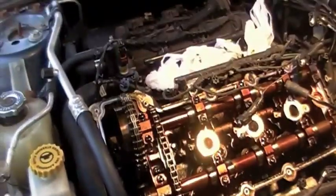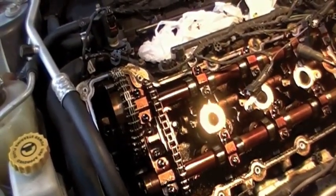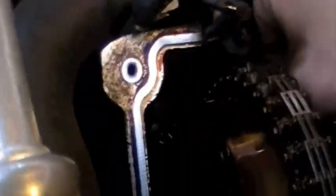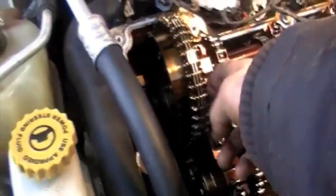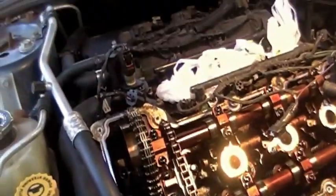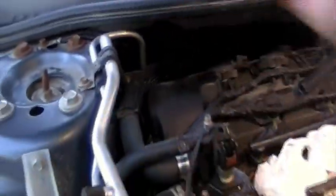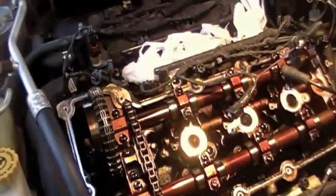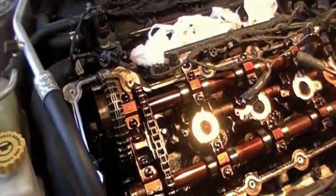You can see the timing chain is loose. Now this engine still runs - I had it running and it ran great actually, but it seemed like it had a bit of a timing chain tick, like a little bit of a clattering sound - that's loose in there. That's because the primary tensioner, which is actually under this valve cover, is screwed in right in the back, almost by the firewall on this particular Sebring, and that fails once you get water in the oil.